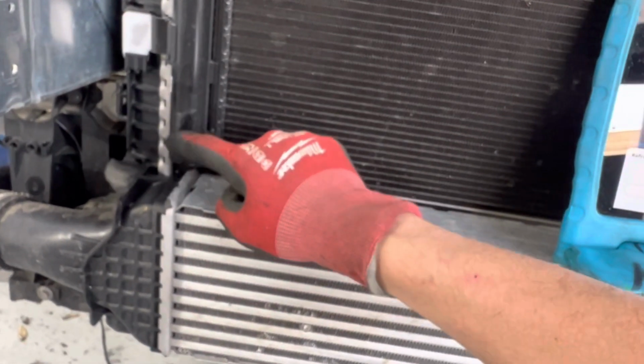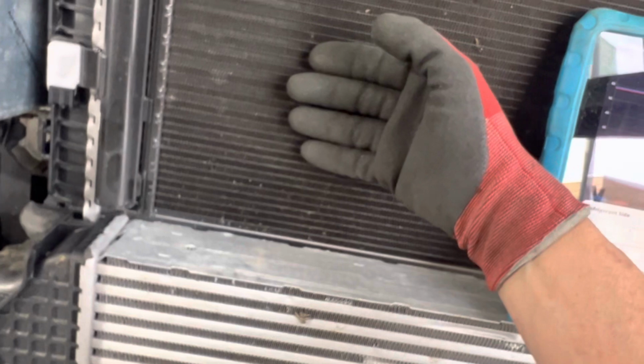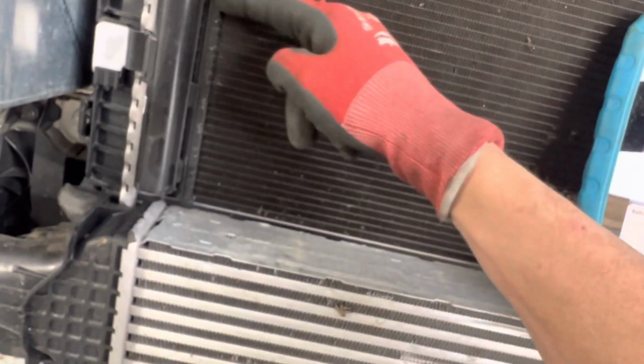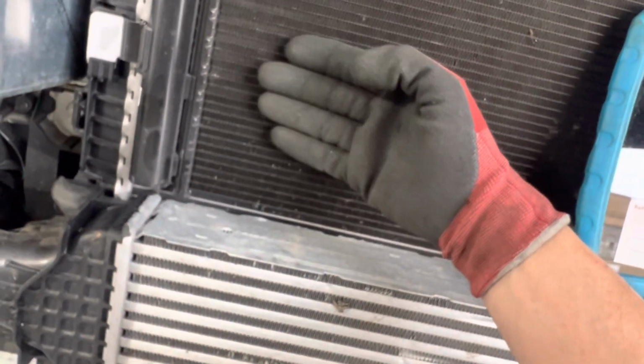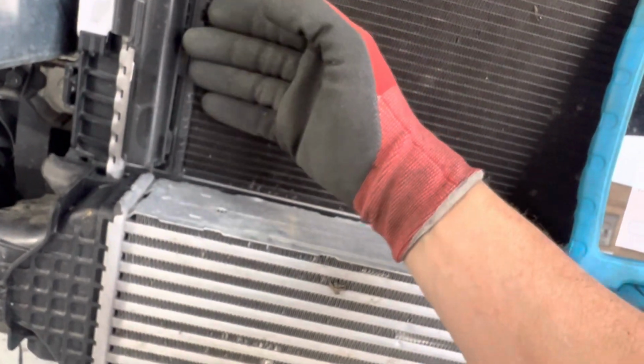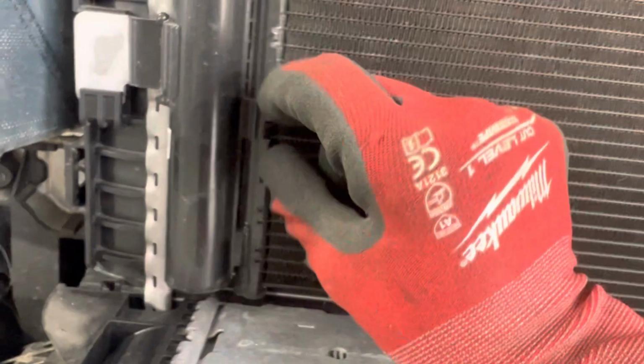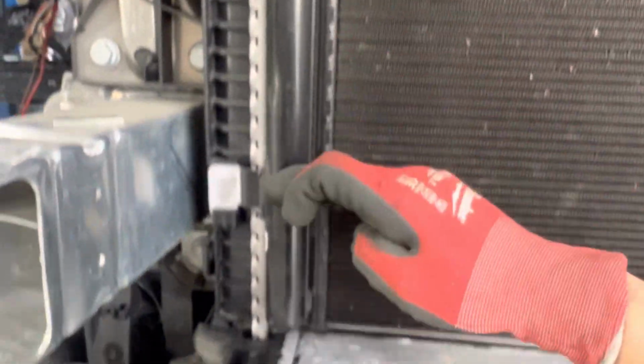There's a little filter in here. And through one of the refrigerant passes, it comes back in several of these rows. Let's say an imaginary 10 rows. And there's a little stop off right here. And this vapor with a little bit of liquid refrigerant goes across, and it all stops right here in this little header spot. And where you see this little connector right there, all that narrows down and squirts into the shell of the receiver dryer.